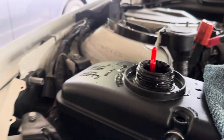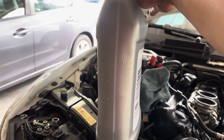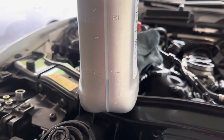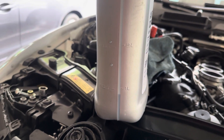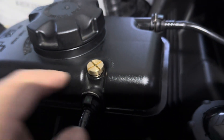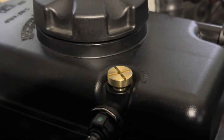We just filled it up. Looks like we used a little over three quarts and have about less than one quart left, which will probably be needed to top off the system when we bleed it — so save this. I have the brass bleed screw now, loosely installed so we can let some of the bubbles escape. Go ahead and squeeze your upper radiator hose a few times, letting some of the air out through the bleed screw as you squeeze. You can see some of it coming out little by little.